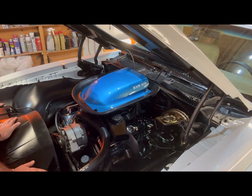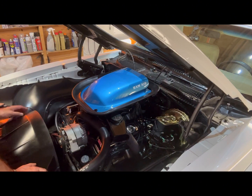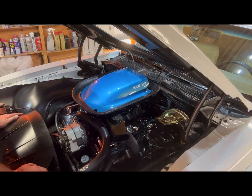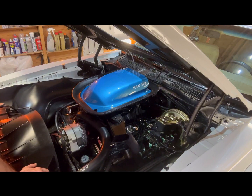So that's what's happened in the last week and what I've done to the car. That's the thing with these old cars and wiring — there's always going to be little gremlins. I've had the car nearly six months and done probably 1,200 to 1,250 miles in it, and that's the first time it's let me down. But I know that trick with the tach cable now — I would never have thought of it. I just assumed there was a lot of resistance in the coil and the coil would burn out, so I would have changed the coil. So that's a good tip for the future: disconnect the tach if you have an ignition failure.